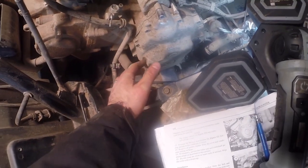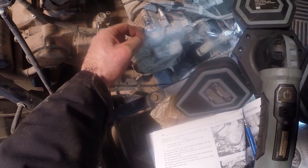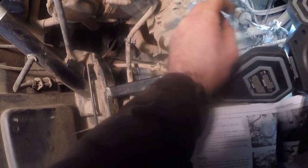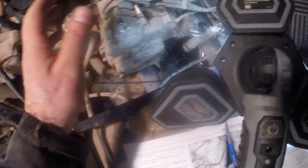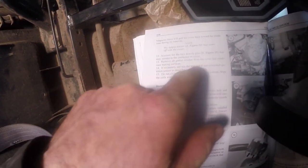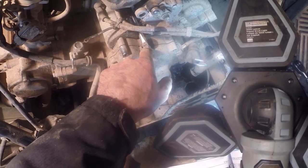This cover - you definitely do not want to pry between the cover and the engine block. You could put a nick in it and it may not seal. It even says right in the manual: do not pry between the two surfaces. What's nice is right here to the right of the starter there's a little lip. I put a long flat screwdriver through from this side, got a helper to use a rubber mallet and tap it, and you can see the crack form here - it opened up.